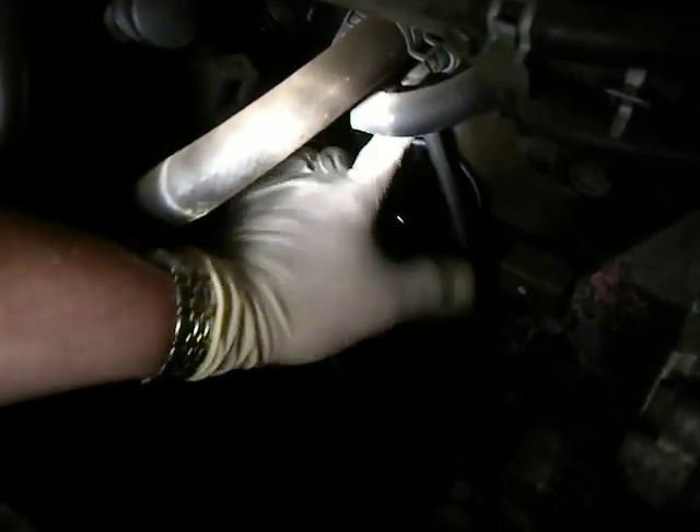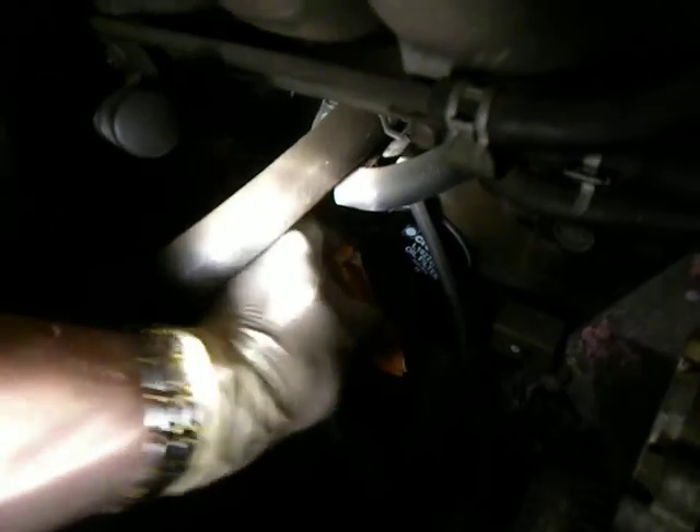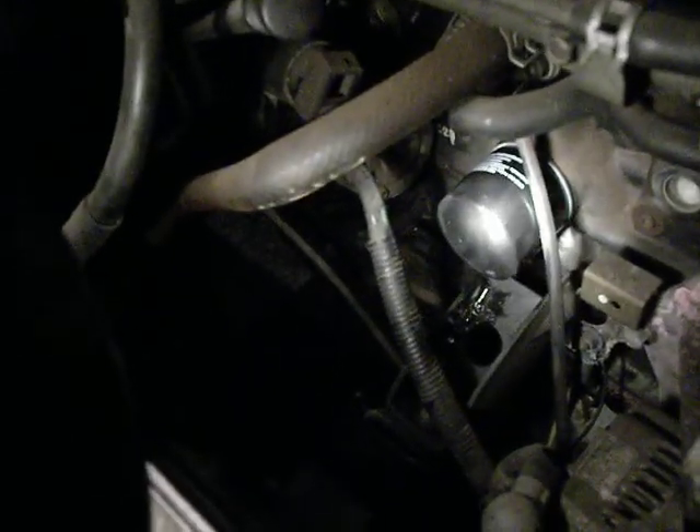I'm doing that up now. By virtue of the fact that there's loads of oil slopping around, it's quite slippery, so if you have some paper towel or kitchen roll handy, wipe the filter off and then give it a good hand-tight turn. There's no sense in over-tightening it — if you had to tighten it with a torque wrench, they wouldn't put a rubber seal on it.